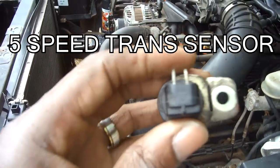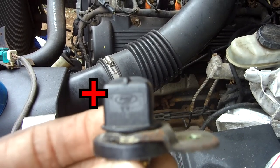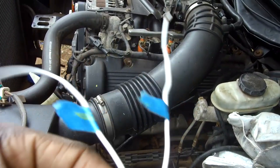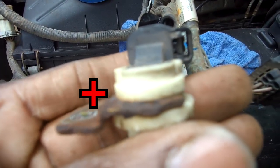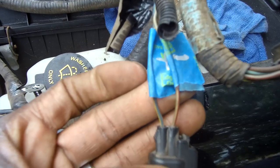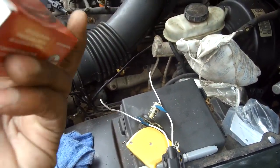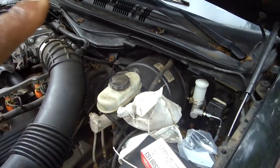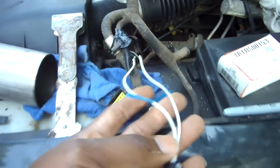We're starting to mess with the OSS system - this is the one that came off of this transmission. On the left side there's a plus and on the right side there's a minus, so that side we have to keep. This is the pigtail I got; I labeled it plus and minus and it goes on one way. Over here on our automatic, we have plus on the left and minus on the right. I went and picked up this standard part - SC468 - which is for the transmission on the five-speed. Mine was broken, as you can see.